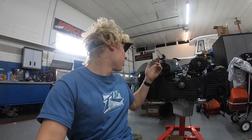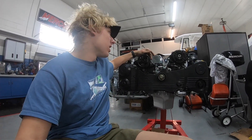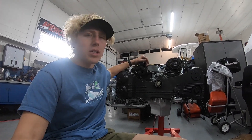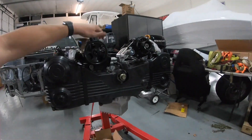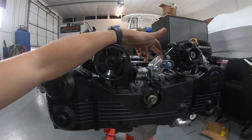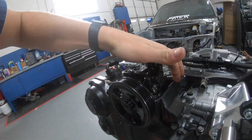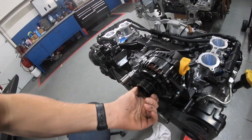Now the feed is at 8AN. If you guys have been watching, you know I installed the radium dual pump hanger and I've recently routed all the lines from the rear of the car all the way to the front. I'm working on building the parallel fuel system on the engine before it actually goes in the car, just so it'll be a little bit easier and kind of a plug-and-play setup. In the last video we installed the IAG alternator relocation bracket, painted the alternator, painted the power steering, and got rid of the tensioner bracket on the stock power steering bracket. Super happy with all that.